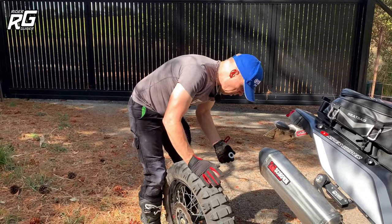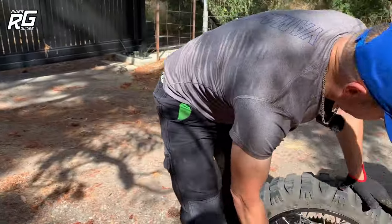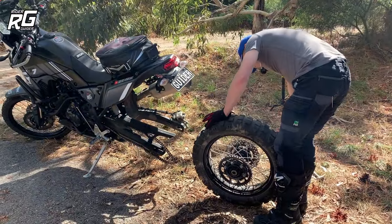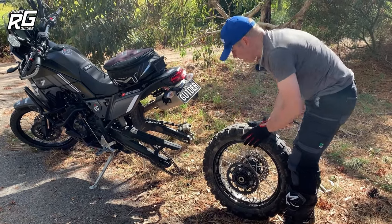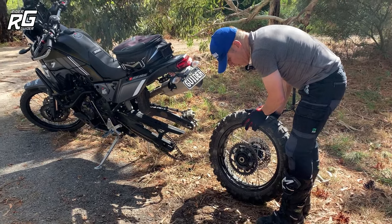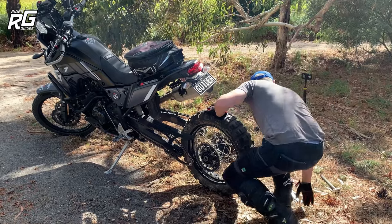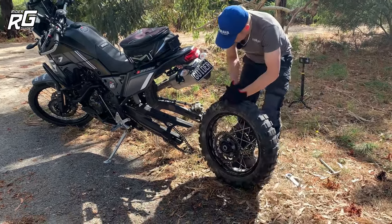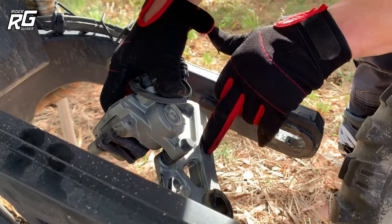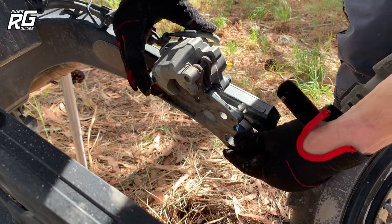The back wheel's off and we're ready to go back. We'd do our repair — puncture or whatever — and then go back in again. This is where the fun starts: the angle of the back wheel we're working with — it's not vertical. It'd be a lot easier on a center stand, I admit that. This is going to be the struggle, but it's better than just laying your bike down without any stand at all. Now let's see the slider — that's got to slot on there and I've got to line up the disc with the brake pads — that's going to be the battle.